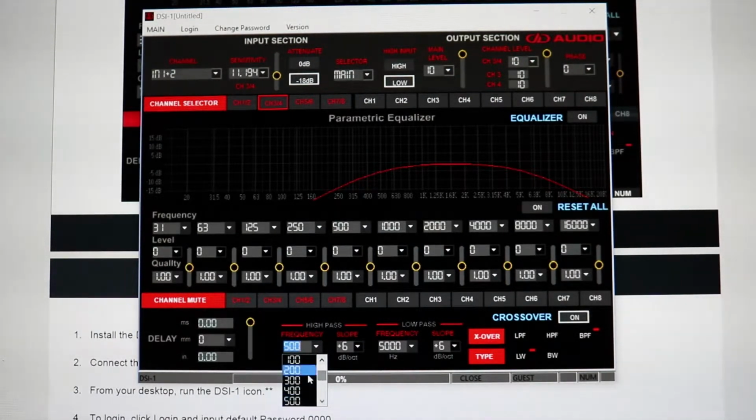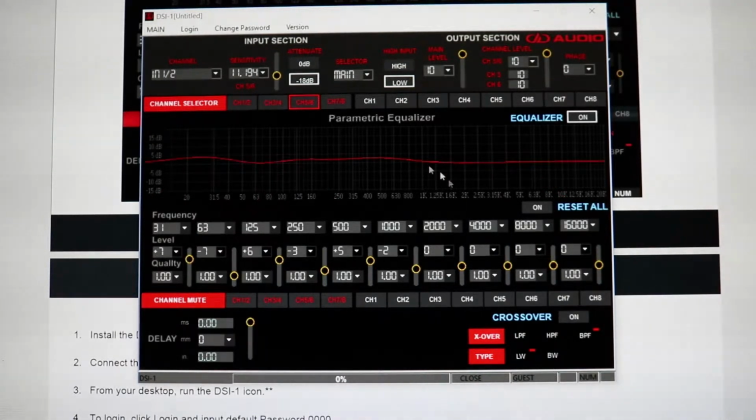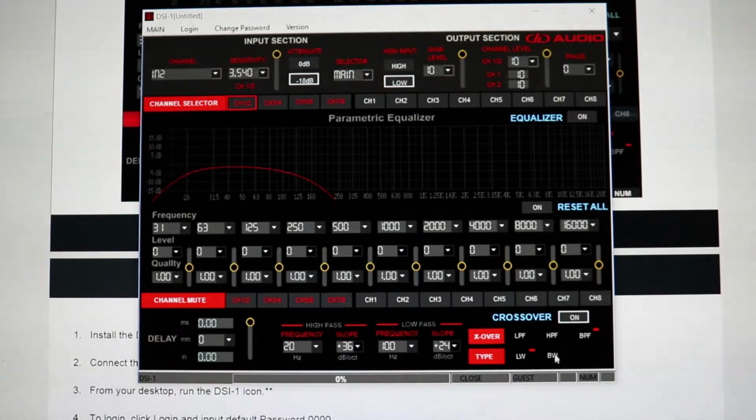So say this is our mids, we'd want to set this high pass right about at 100 hertz, and the high end of most of the mids is around 4000 with a softer slope. So now we have our channels 5, 6. We can turn that off. And then we could turn on this for our tweeters and go down to 4,000 as the high pass, just as a high pass right there, you can see, with a soft slope. And on our channel 1, 2, you can also turn this to just a low pass, so then you just have a flat curve going out. And then that's basically all those.